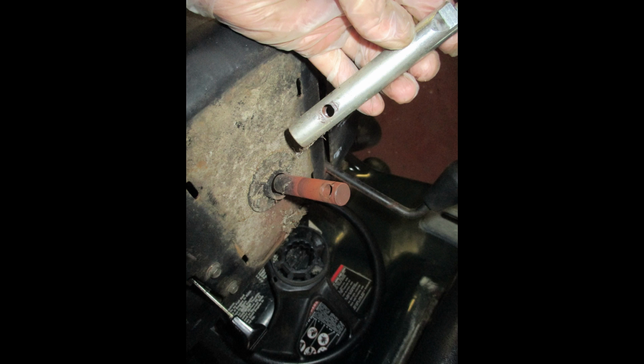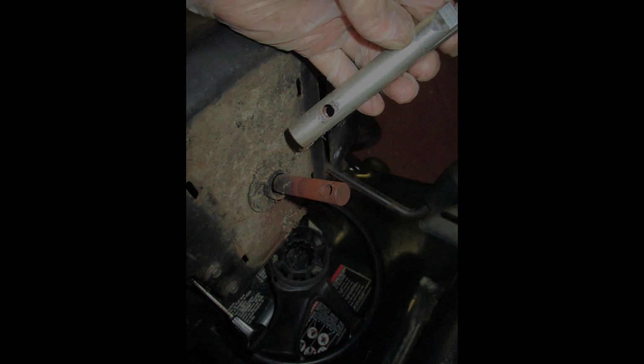Down close to the steering gear, use a pair of vise grips on the steering shaft. Then with a wrench on the top of this steering adapter, where the two flats are, turn it until it is 90 degrees away from the steering shaft bolt holes that you see here. Now when you've turned it 90 degrees, you'll have the solid part of the steering shaft, not the holes, but the solid part of the shaft. Then take a hammer and tap around the bolt holes on this adapter, and it will smooth the holes out to where you can pull the adapter straight off.